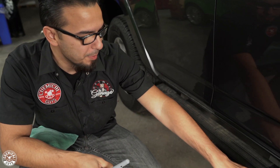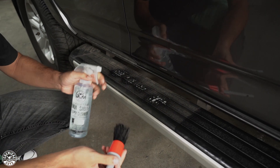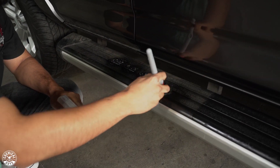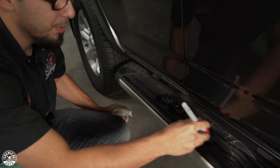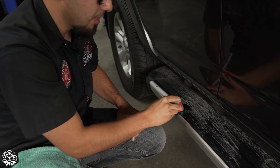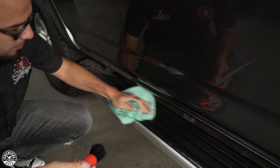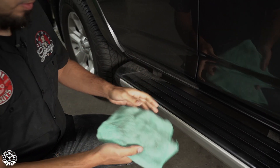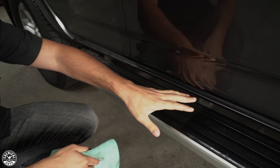What we've never done before is — I know we've dressed one side — but we've left the other side dirty for the comparison. I'm going to clean it just to show you what it looks like even when there's no dirt on the surface. Again, with the Nonsense. Although this bottle looks full, it's actually been diluted 10 to 1 for cleaning jobs such as this. If you're wondering how to dilute it, these bottles have a ratchet-style locking neck — just squeeze the sides of the neck together to unlock the ratchet, then unscrew as normal and dilute to whatever desired dilution ratio. So now you have dirty, clean and dry, and dressed — giving you a little perspective of what exactly the dressing is doing. It's not only making it look better, looking deeper and darker, but it's also going to protect against harmful UV rays and help it last as long as possible.